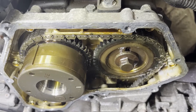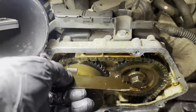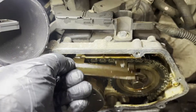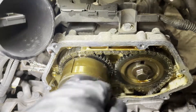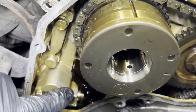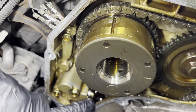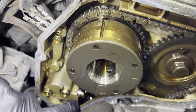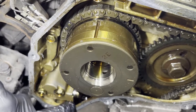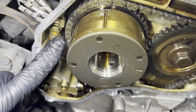I have other hard evidence that this chain slipped. This is your upper guide that I have on the workbench. This thing was cracked and was just sitting in here. It fell down on top of the chain, but with the cover on it had nowhere to go — so I slipped this off. This is a broken guide, and that's not going to help the chain tension. Look at the actual automatic chain tensioner that feeds oil. You see that nice shiny mark on the nipple? That means this chain recently skipped and the nipple came forward to take up the slack. That shiny mark is recent, and the oil stain in front of it proves that the nipple was riding to the left, back a bit, before the chain skipped.